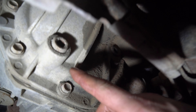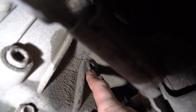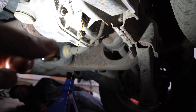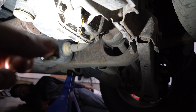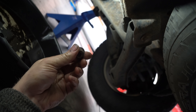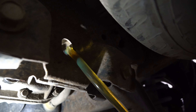Alright, this is the rear — it's got a drain and a fill. Take out the fill one first, then pop your ratchet in and loosen off the drain plug. Pull the plug and let it drain. It's thick stuff, so if the fluid is cool it's going to take a while to drip out — don't rush it. Then put some thread sealant on the drain plug and pop it back in. Slide the filler pump through that frame hole and it goes right in.